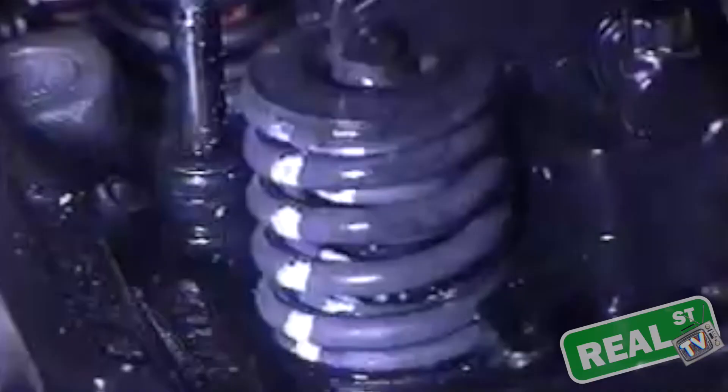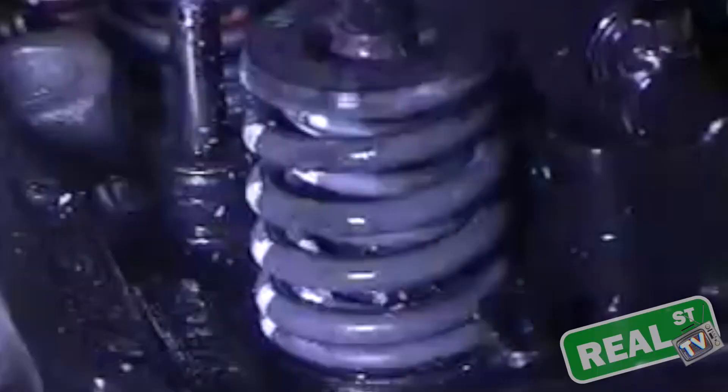Harmonics are basically what's going to drive your valve train into a frenzy — into valve float. We're going to post a clip here of an engine on a spin-tron. The spin-tron is a machine where you run the valve train on its own using a high-speed camera and you can watch the stability of the valve train.